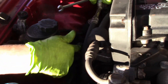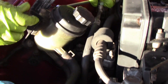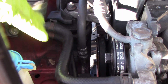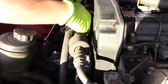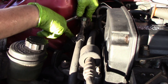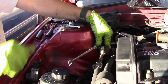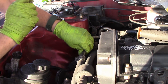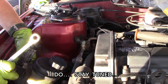All the belts are on, motor mount is done. Just tightening this up a little — all the other bolts are tight. Putting down the power steering reservoir and tightening that up. I did a final tighten on the water pump pulley but they're quite snug. I re-plugged in the sensor I had unplugged to gain access. Tomorrow when I come back I'll finish with the alternator tensioning and burping the system — and I guess that's it because everything else is done. Hope you guys found this educational and helpful, and I might bring you back for the final startup.